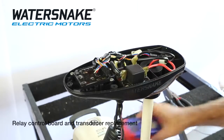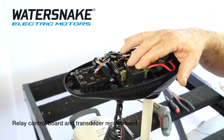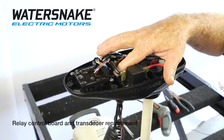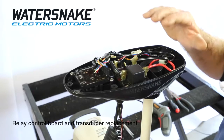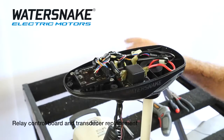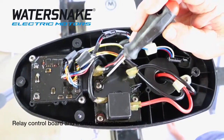We're going to assume for demonstration purposes that this is faulty and the voltage isn't right, or this little tilt switch in here has seized up, which cuts the power off to everything. It actually stops the motor going over centre. Once it's laying flat, it will not operate because of that switch. So there's 3 screws that hold it on.